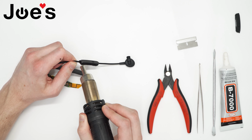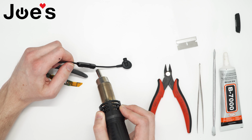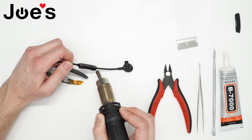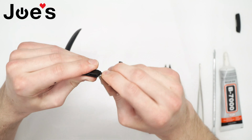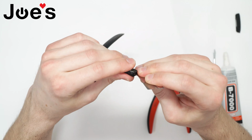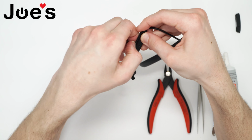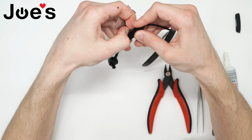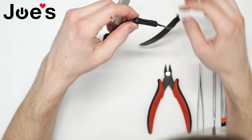We'll start with the inside where there's the two buttons for the noise cancellation. We're gonna get those two sides first. You just have to heat up the edges, not the actual buttons, because there's no glue there, there's only glue on the edges. You can peel it up over here on the bottom end, the top cover, and get these two buttons out, the rubber of them buttons. We'll need those for later.